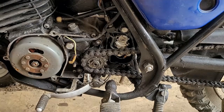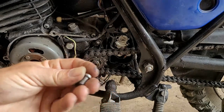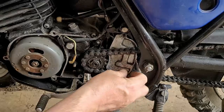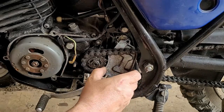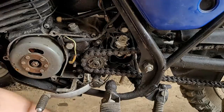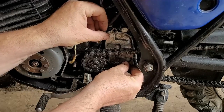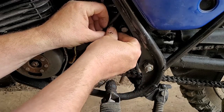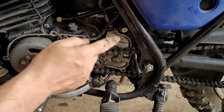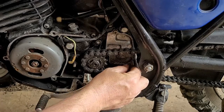It was missing one of these screws — he had one and I have another. These right here are half-inch, 13mm screws lengthwise. We're going to take his cover and fish it in there — it can be a bit of a pain with the chain on it, but we'll get it. Actually, it wasn't that bad. Always verify that your oil pump is going in the right direction.